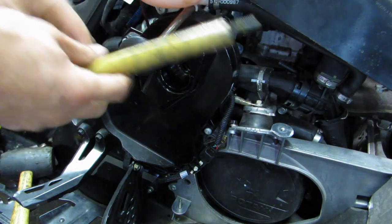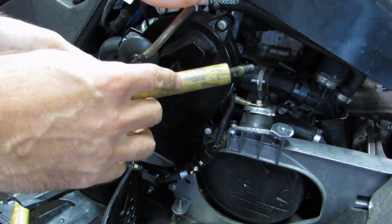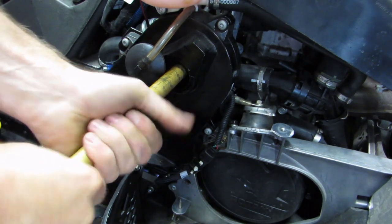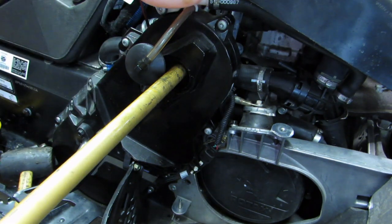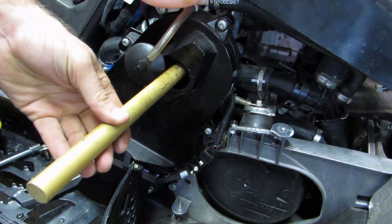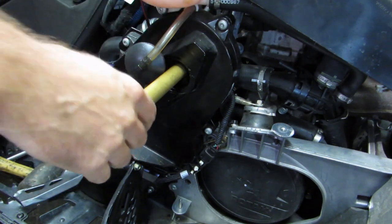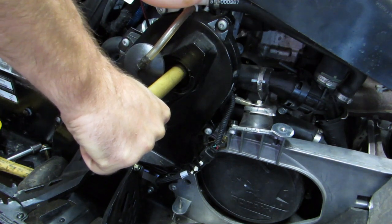What's really handy is if you have one of these tools from C&T Power Sports. It's got a threaded rod on that end — this is the same diameter as the shaft — so you put it in here and screw it all the way into the end of the shaft. What that's going to do is hold your top gear and chain from dropping down and slide through the bearing and the oil seal that's on the other side. Then take a rubber hammer and tap it. Slide that through a little ways so you know it's through the seal.